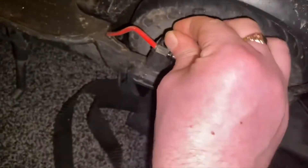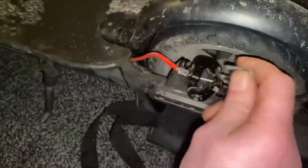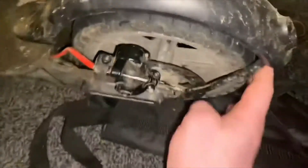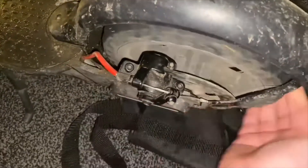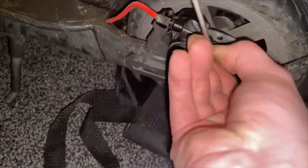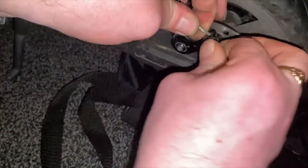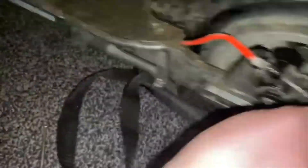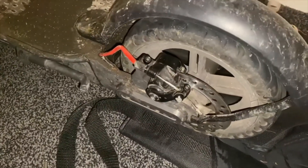Once tightened up, release the brake lever and turn the wheel to make sure it actually spins freely. As you can see, there's a gap between the brake pads and the disc — perfect, meaning they won't rub. If there is any rubbing, use the 5mm allen key to adjust. You can also adjust by the cable: loosen the bolt, pull the cable out a little, and tighten back up. There's also the little black adjuster on the cable. It feels smooth now — not rubbing. Hope you guys enjoyed this one!